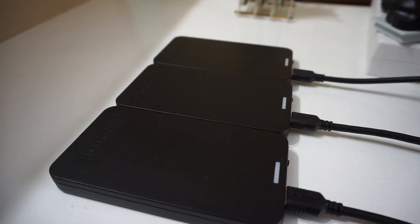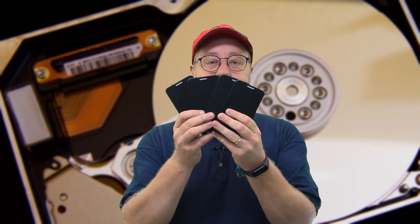After two comes three, but those results weren't interesting enough to include, so I jumped to four hard drives. With four drives I used a RAID 10 configuration — two pairs each in RAID 0 for striping, and then the two pairs mirrored as RAID 1. I tried both setting it up manually (creating two RAID 0 sets then a RAID 1 on top) and letting the Linux RAID controller automatically create a RAID 10 with all four devices.